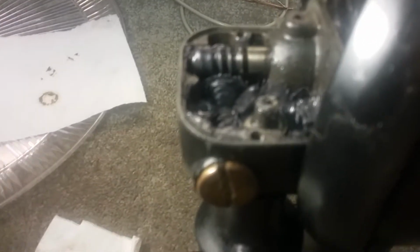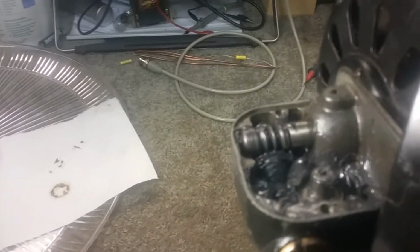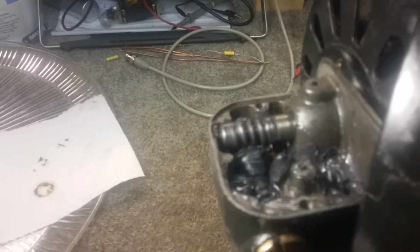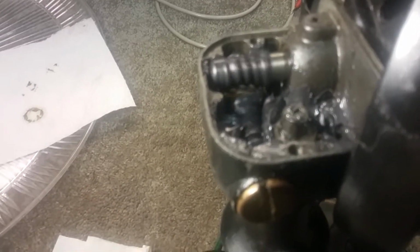And you see I got it on 50 volts and it's already turning very little. So I'm going to crank the voltage up. And you see how that just pulls that grease right into the drive. When you have old dried up grease in there, it won't do that.